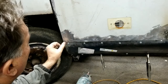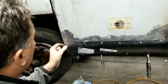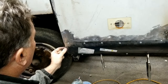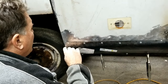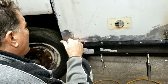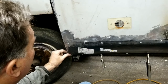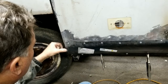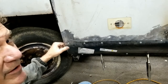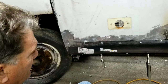When I get all this welded here, then I'll tap this down and weld against this edge a little bit, and then I'll grind this down a little bit more so it's a little more flush. Grind it down so it's nice. It'll transition. Being a round corner, it helps a lot to hide stuff. So you can even, if you had to, put filler on the actual dog leg and then scribe it with your wheel.